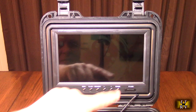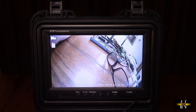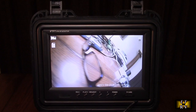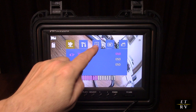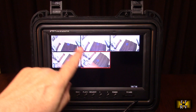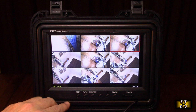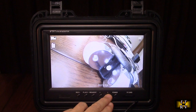When taking the TF card out or putting it back in, shut the unit off first. When you power on the unit you get a welcome screen, then the menu comes up and the camera is active. To review pictures, hit the menu-exit button, scroll to the pictures tab, hit record-minus, and you can browse through all the pictures you've taken.